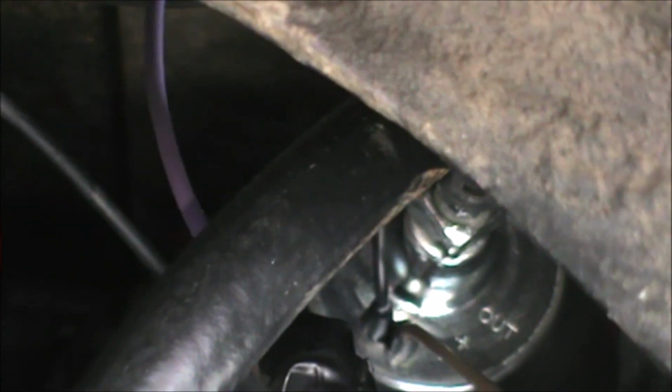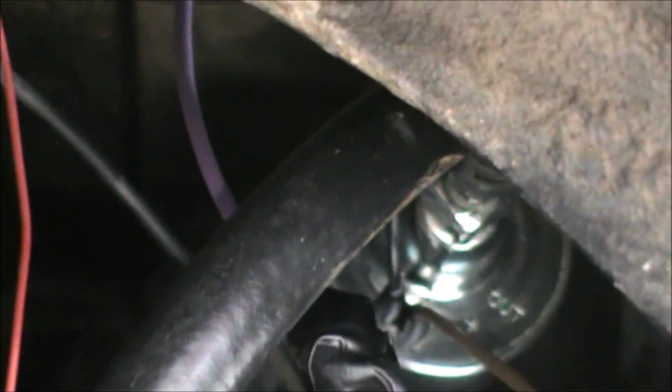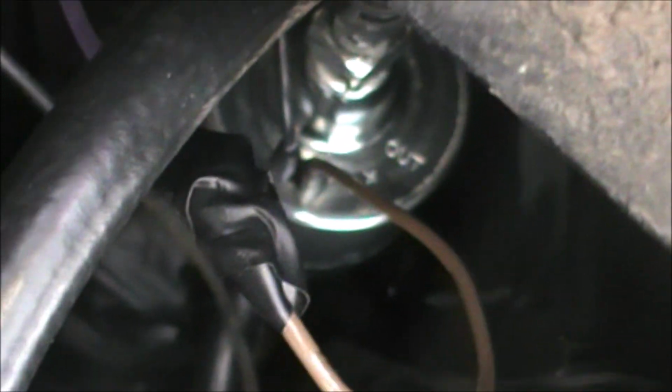Alright. So upon closer inspection, I think the leak is actually coming from the line. I just think I need to put a worm clamp on there. Well, just need to go and get said worm clamp, put it on. I'm going to have to wait till everything cools down because I'm not giving myself third-degree burns in the process. So anyway, that is it for today, everybody.